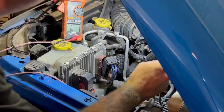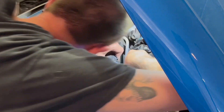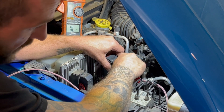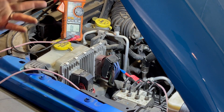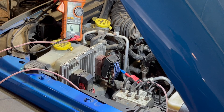By the way, a special shoutout to Joe over at Joe's Auto Electric - he sent me these really long leads for my meter, super convenient and really nice of him. We got infinity - OL on cylinder 6. Let me make sure I'm in there good. Yeah - so we've got a bad injector or that wire going to that injector is no good. We just verified that. We're going to pop that manifold off, get a new injector in there, and call it good.